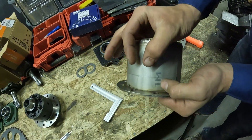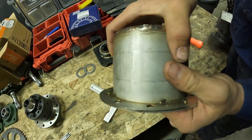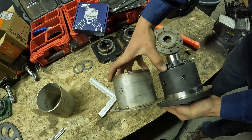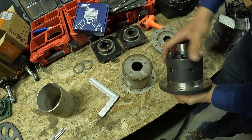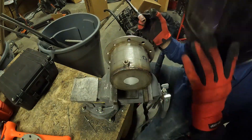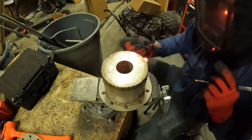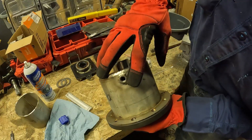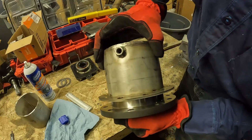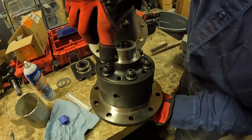If you're going to do grease, you can just weld a chunk of metal right there, round it, drill a hole through it and tap it for your grease fitting. But I'm going to do oil, so I'm going to do some kind of bolt. I'm probably going to put it up on the side of this right here so it clears this and the oil can pour in easier. That right there is where we're going to put the oil in — it lands right above this so it'll go right into the space and into those holes. We're going to need to put gasket maker or silicone or something around that and around this top piece right here.